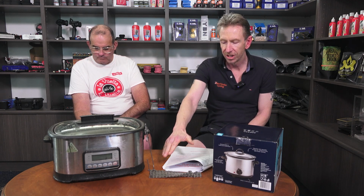The pressures inside your chain, due to the small parts, basically the loads in there from your pedaling, reach into the thousands of PSI. After 10 minutes of riding, you're going to have the same amount of wax inside your chain as if you just removed the chain when it was at 90 degrees and hung it to set on a 40-degree day. So all you're going to get by standing there and waiting for the wax to cool right down to near its set point and taking it out is a heck of a lot more mess once you start riding.